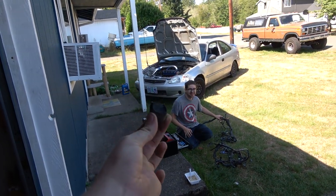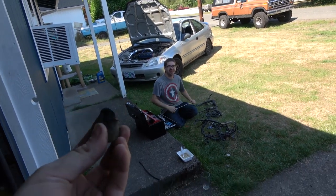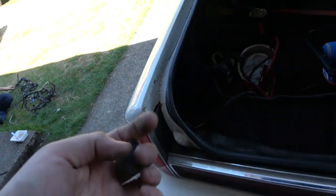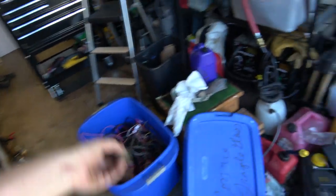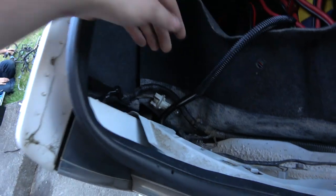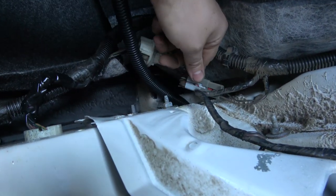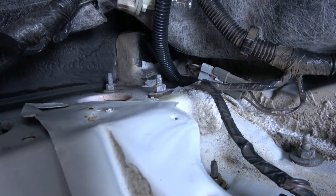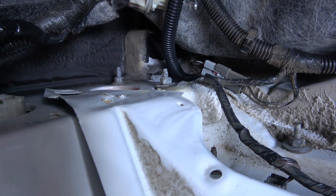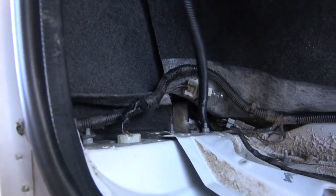Adam's got his butyl tape — not my favorite, it can go to hell. Okay, I thought we were going to have to drill a hole but I was wrong. Above where the license plate harness goes in — that's what this is for, license plate lighting — there's this big old hole with basically butyl tape in it. The center just pops up and you can run your harness, and it's actually just the right size hole for this conduit. So that's that — it just runs through here and goes up in there, and you're done.